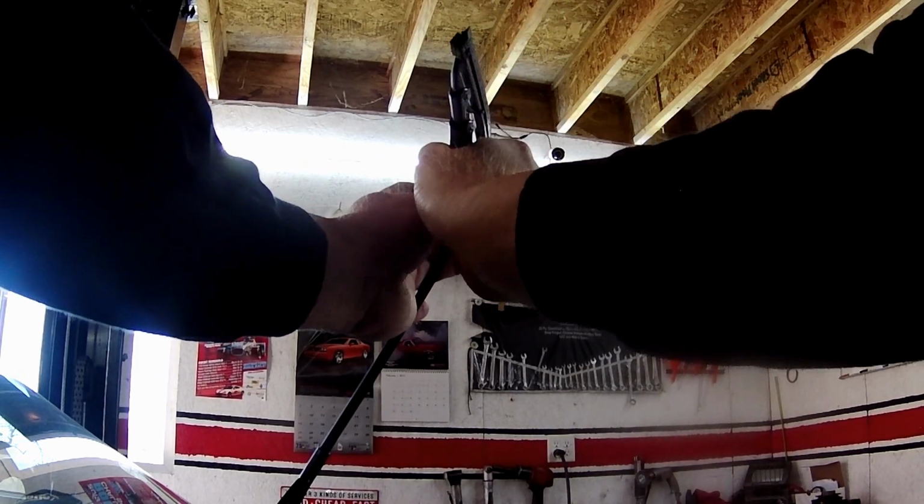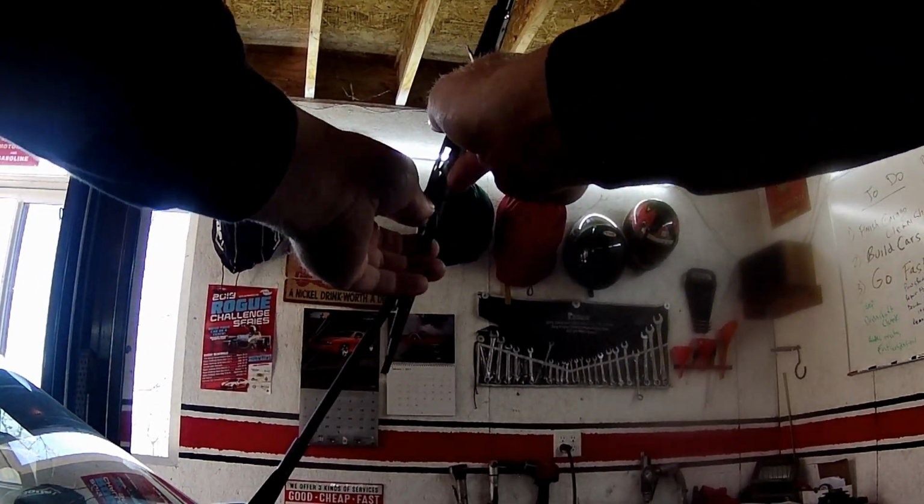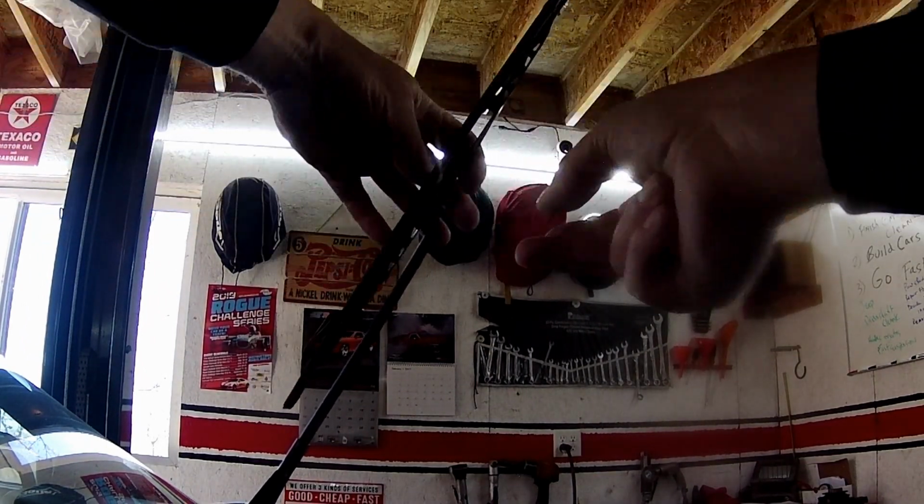The wipers were folded over, and I wanted to change them before somebody accidentally turned them on and scratched the windshield. It's a straightforward job. Just press in the clip and push them out. I use a small screwdriver inserted between the clip to get it to release. So that's done too.